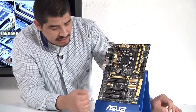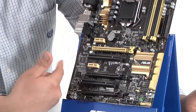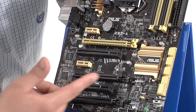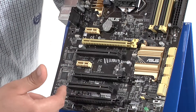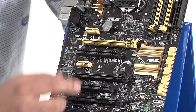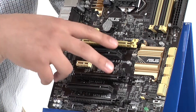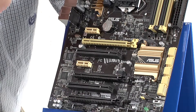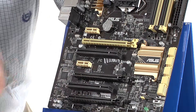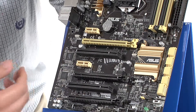The PCIe slot expansion is quite capable. You've got an x1 slot, an electrical x16, a legacy PCI slot for older sound cards or capture cards, another x1, another physical x16, another PCI, and then another physical x16. The board fully supports Crossfire and SLI: with one GPU it runs full x16; with two GPUs in SLI or Crossfire it's x8/x8, which is x8 Gen 3 — technically equivalent to x16 Gen 2, so more than enough bandwidth. The last slot's speed can be configured within the UEFI, giving you a huge amount of connectivity.